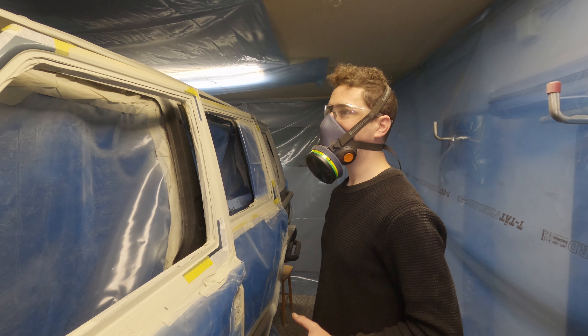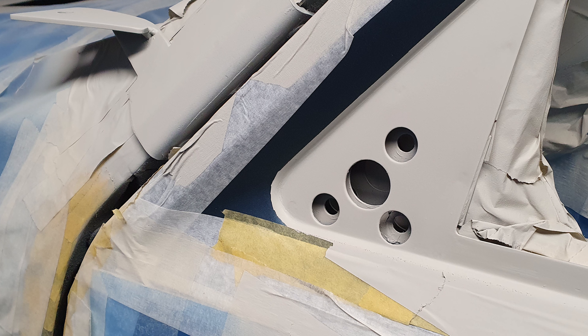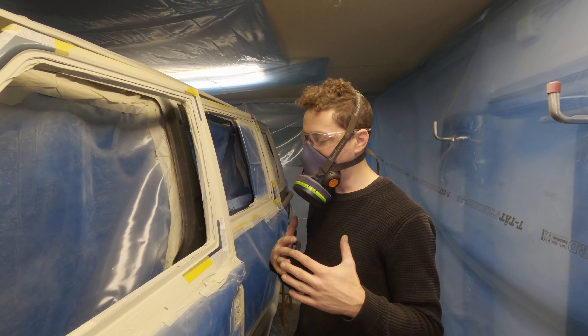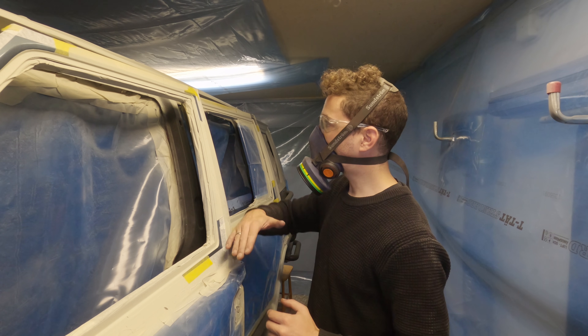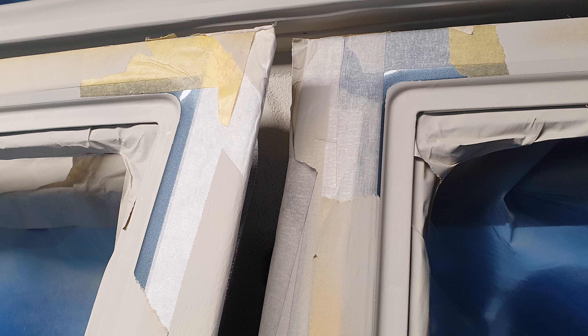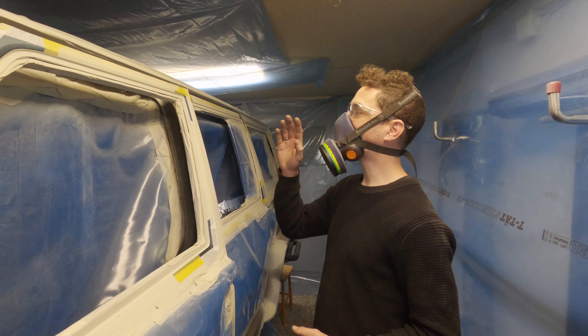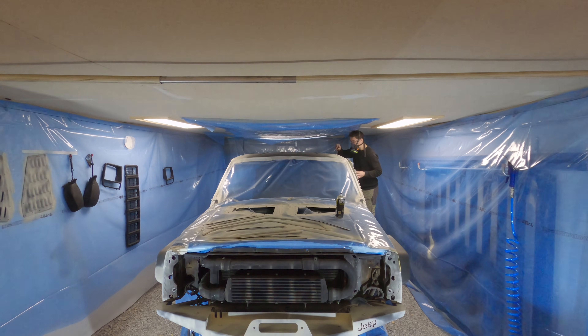I've finished priming most of the vehicle and used two cans of primer so far, with one left. I've unmasked some of the fine line masking tape, which is coming away really well. I was concerned on these corners about overspray going underneath the tape, because as you spray on the tape it tends to get a bit wet and lift away. It's pretty good on straights, but on corners there's probably a better tape out there. You can see the edges are pretty clean. I'm going to re-mask a lot of these bends on the corners, but all in all I'm pretty happy with how it's turned out. I still need to get up top, check out the drip rail, and maybe run a brush along the inside edge.